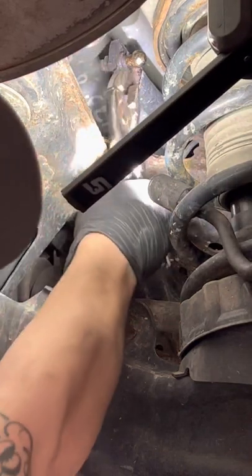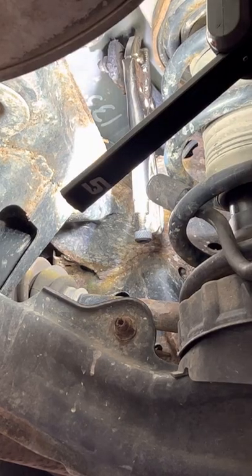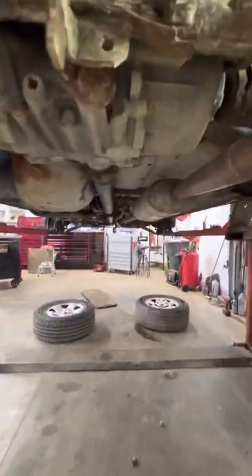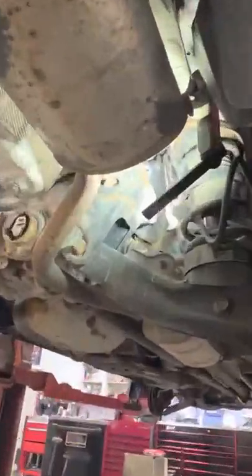So I take a set of vice grips and put those on there. And then what I do — I come up here on the diff, up under by the rear subframe where the differential is. And then I take a really long three-eighths extension with a 14 millimeter swivel and run it right up through here, put it right on there. So then it's running out here and I'll take my three-eighths impact.